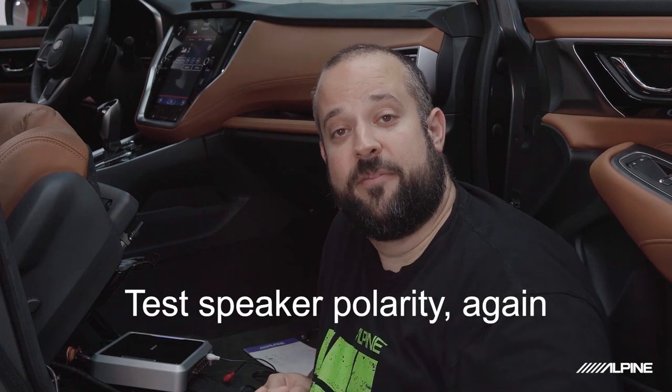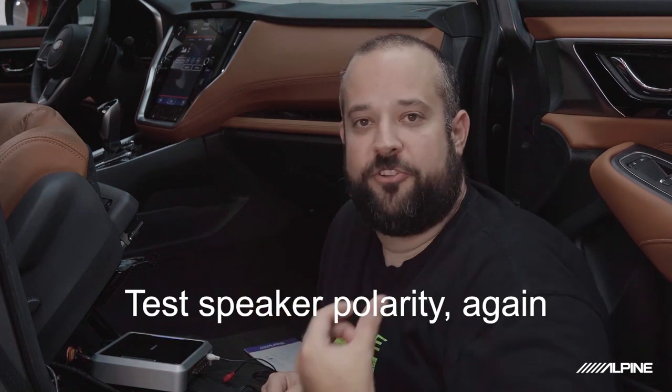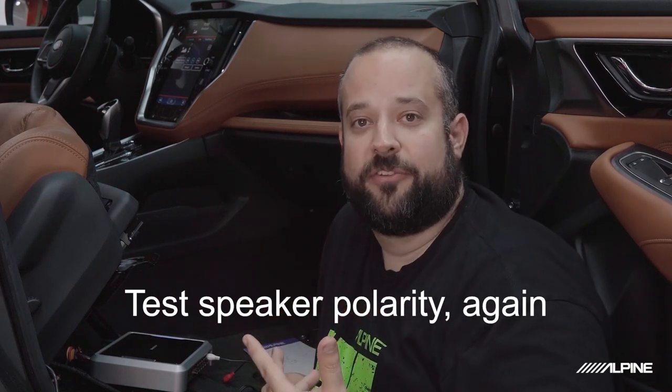The other thing you're going to want to do is grab that phase checker again, like we did at the beginning. Go around and double check everything. Make sure you hooked everything up correctly and give it another test. It only takes about a minute or two, and it can save you a lot of headache down the road if you end up having the speaker out of phase while you're tuning. So go ahead and just do that, and then you're pretty much set to go.